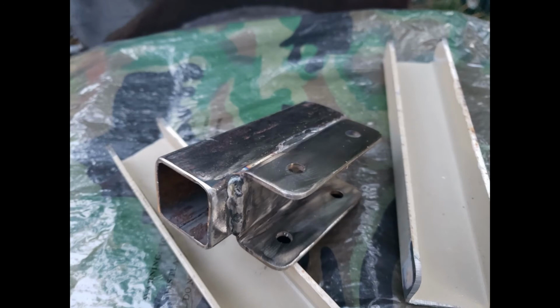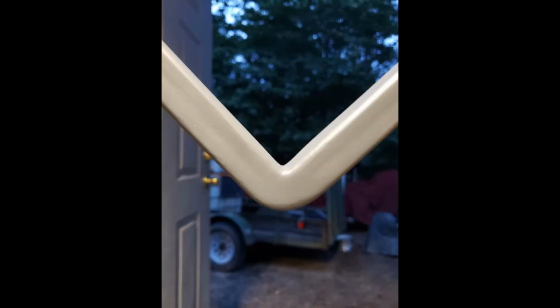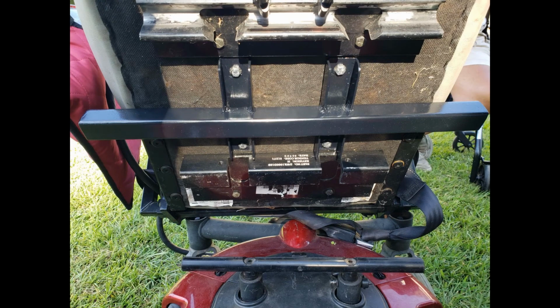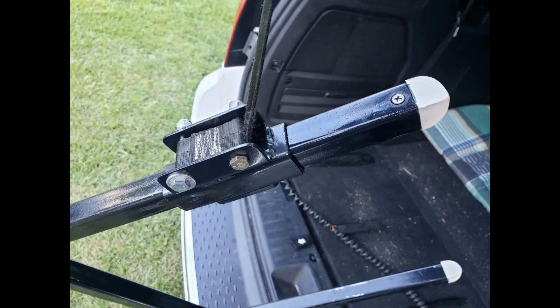Reinstalled the grommet and then ran down the driver's side, running the wire underneath the trim pieces at the doors and behind the side panels in the back, crossing over to the lift. That went pretty easy once I found a place to go through the firewall.